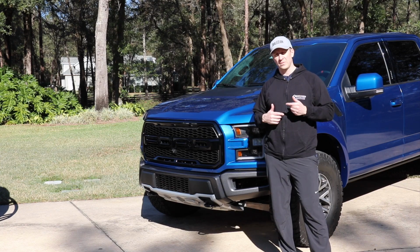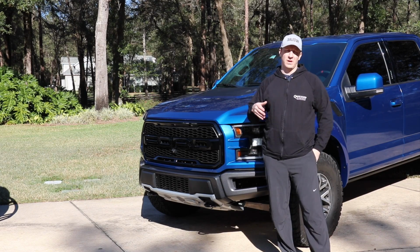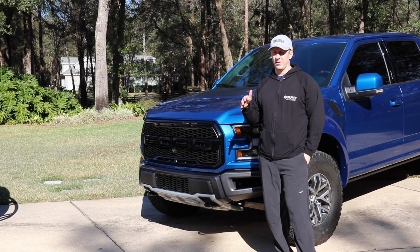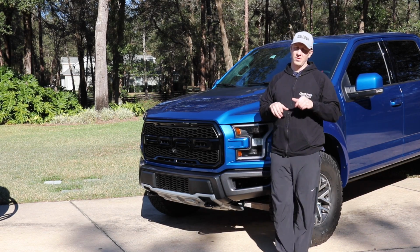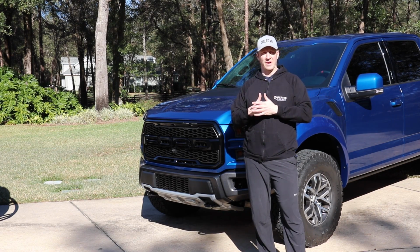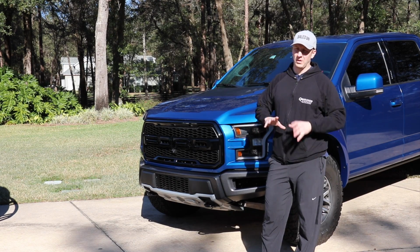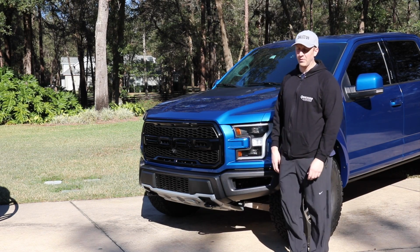If you watch the series where I compounded and completely corrected the truck and then coated it, there was a run, and then there was polish that was flung all over the side of the truck. So we ended up having to have the whole fender sanded, that whole spot, then blended, because for whatever they did with the rotary, they heated up the paint so much that they separated not only the paint but the base layer from the fender. So Ultimate Auto was able to go in, sand it down, fill it, and then blend it without having to blend the hood and the other panels. They were able to spot fix that one spot.